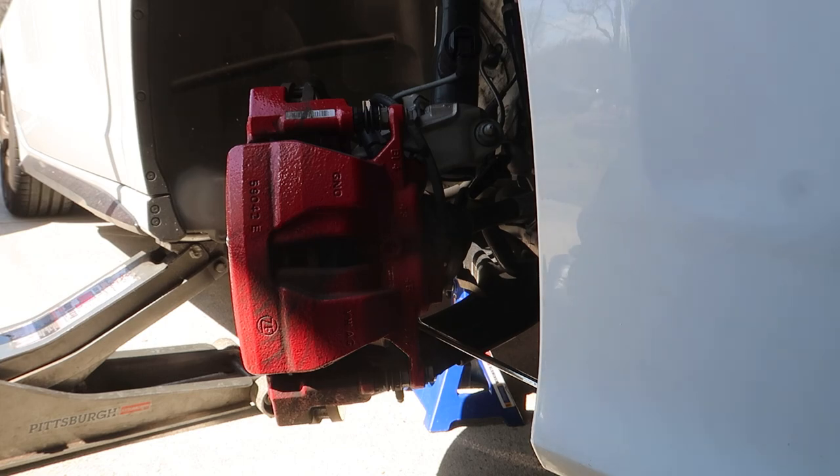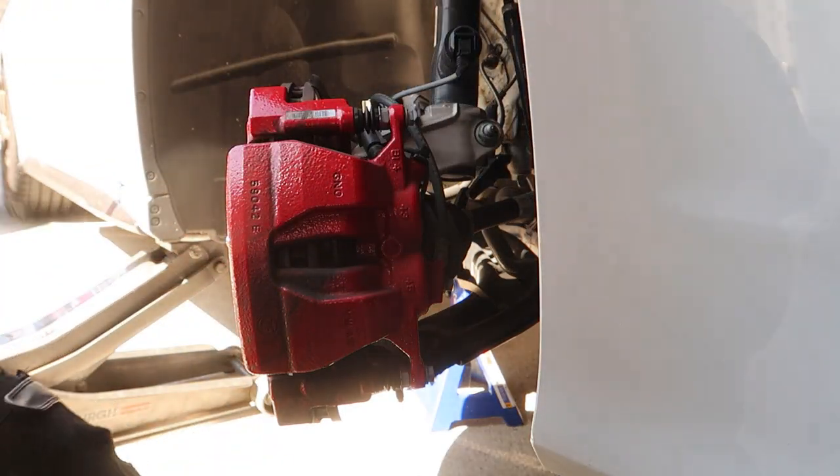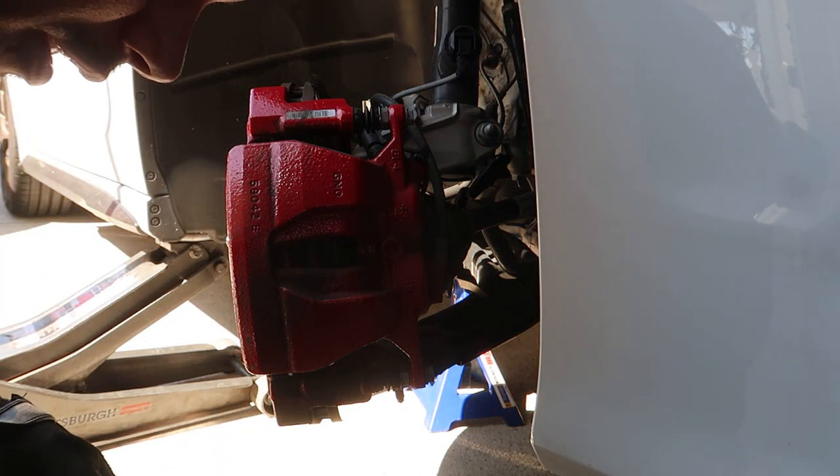Next up, let's break this bad boy loose. Now there we go. If your ball joint is spinning, you will have to stick a T45 in the top of that and continue to get the nut loose. You're not going to be able to do that with the axle in, so you'll have to take the axle out if your whole ball joint is spinning — it kind of sucks.